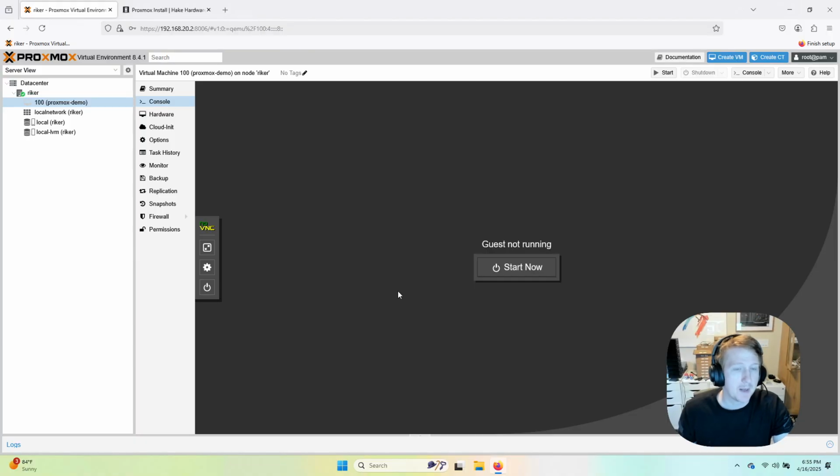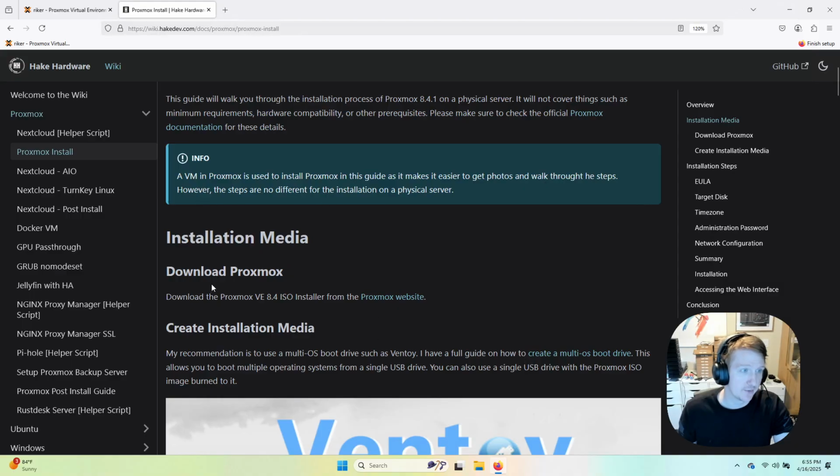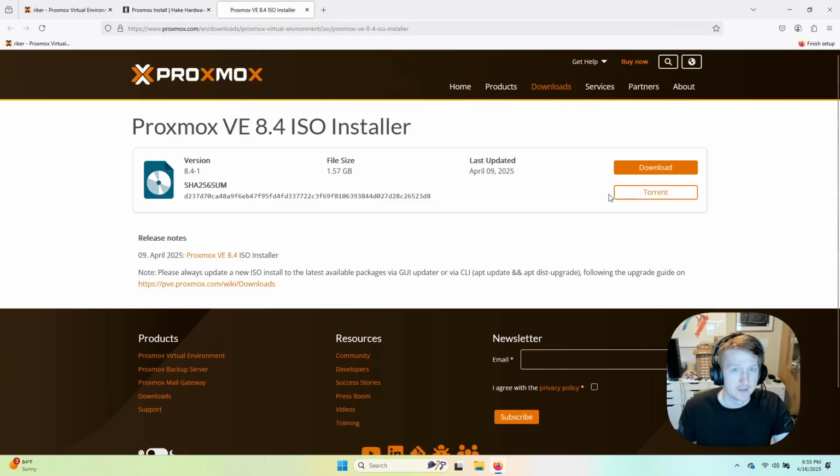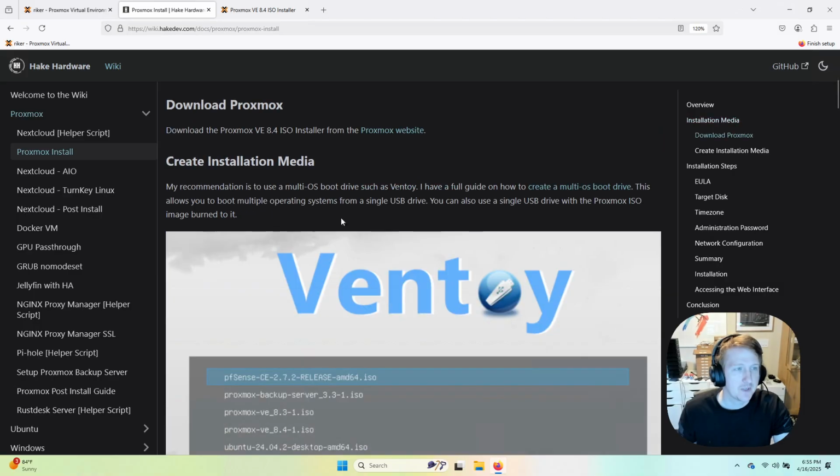And we're just going to start out by booting into our USB disk. Now, first you can download the ISO just from the Proxmox website here. You'll just click the download and that'll get you the latest version, which as of this video is 8.4-1. And then I recommend using Ventoy.